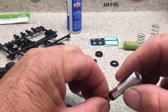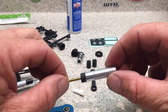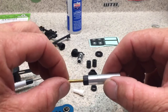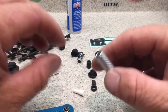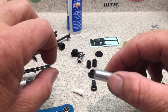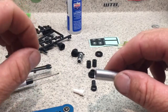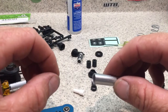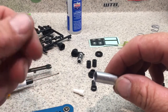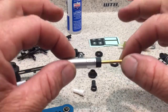When you slide that in, make sure everything is smooth. You'll have some drag since there's no oil yet, but if it feels like it's binding, take it apart and slide your piston on the other side to check the size. Some pistons that come in kits aren't 100% correct, so you may need to use a knife or sandpaper to clean it up a bit so everything is smooth. When suspension binds, it doesn't let your suspension react like it's supposed to.